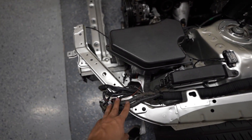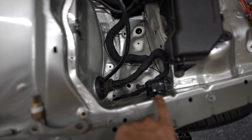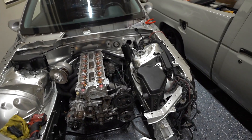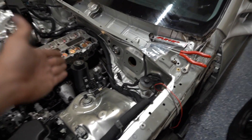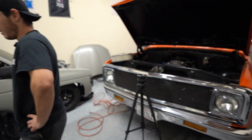I started cleaning up the rest of the wiring — I still have this side and the other side. I ran a tuck through for the harness underneath, already deleted the ABS so you can see how much cleaner it looks. Set up the boost controller and all the Link ECU goodies. I wanted to mount the fuel pressure regulator here on the intake side but it's super tight, and I didn't realize how much the master cylinder sticks out right about here — so that's definitely not going to work and I have to figure out a new place to put it.